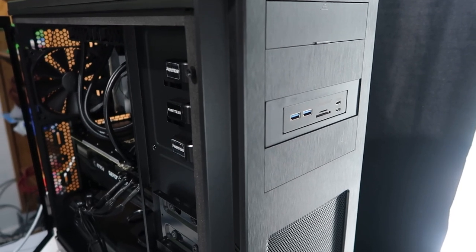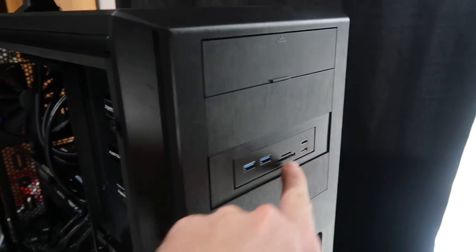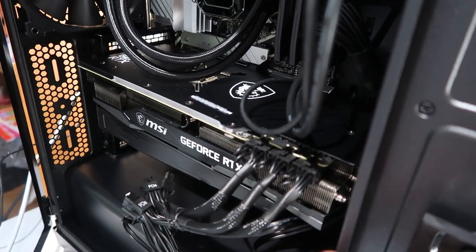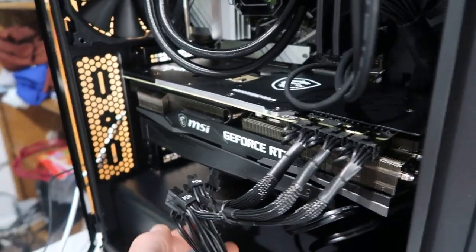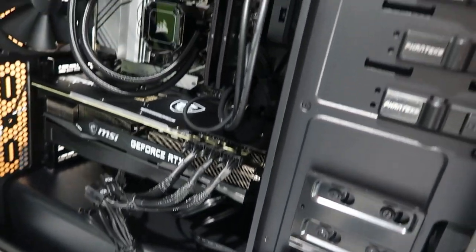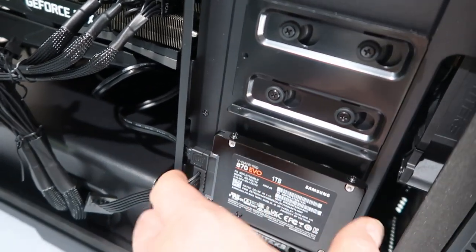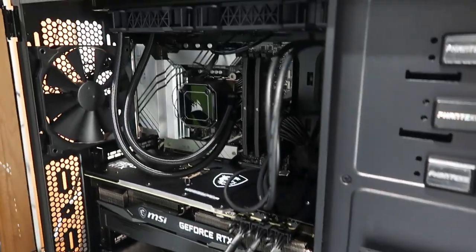That plate wasn't going to fit, so I had to wait several weeks for a new plate so my SD card reader would fit inside the larger housing. The graphics card needed three PCIe power slots, and then I had to power up the motherboard as well. I'd never used a case where all the power cords were tucked under a metal plate — I like it, it makes things look a lot smoother. I was able to pull cables from the back to hook up to the motherboard. I also had to assign a drive letter to the new drive in settings.